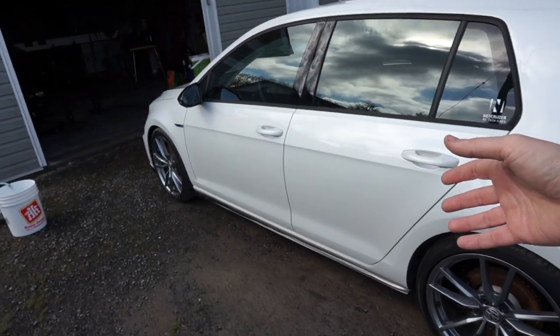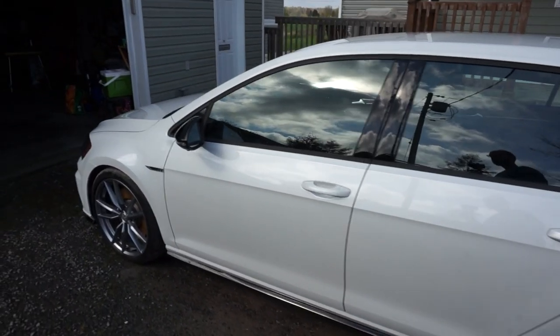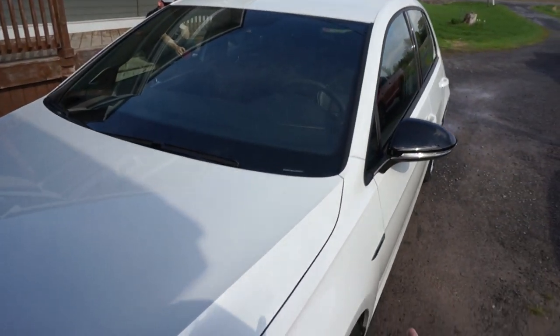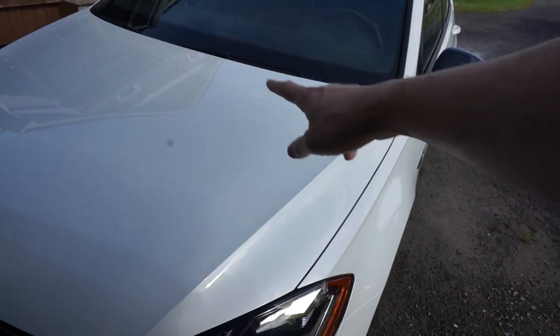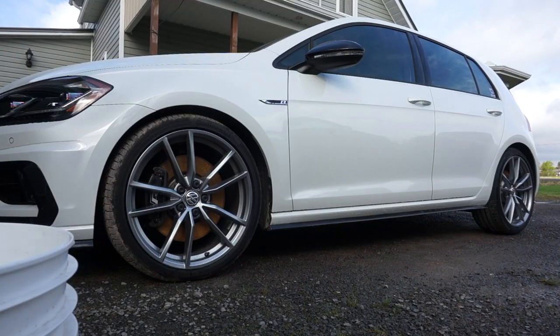After decontamination, I think I'm almost ready to start the DA polish. Even though this is brand new factory paint and it's only ever had one hand wash so far, there are a couple of swirl marks in the hood that I'm going to try and buff out before I ceramic coat this thing. Let's magma it up.